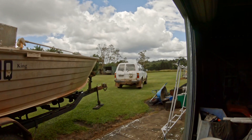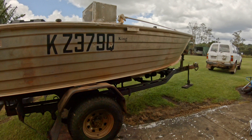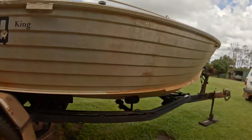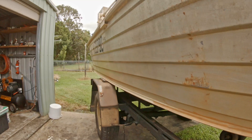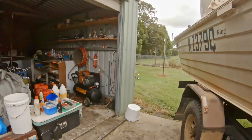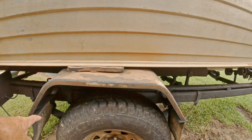On the front of the Toyotas they last really well because you use them all the time and they stay pretty well protected and dry. But on the boat trailer they get a lot more stuff around them and because you only use them every now and then, the actual boots around the pistons perish and then let the dirt in and that seizes the pistons.